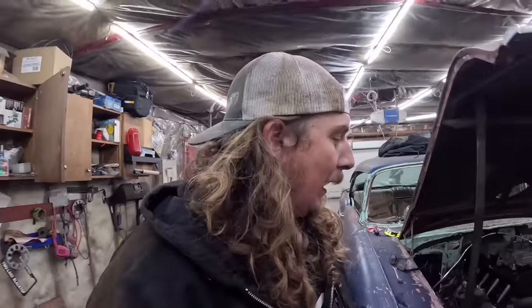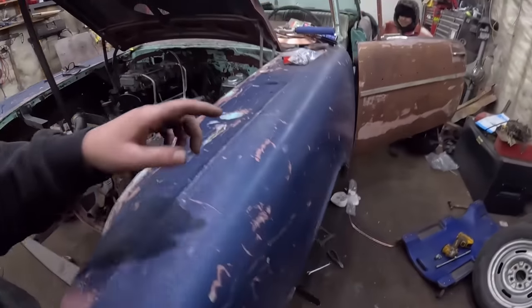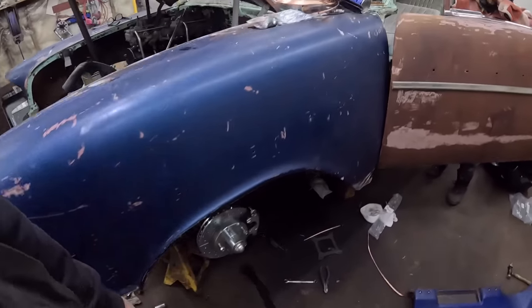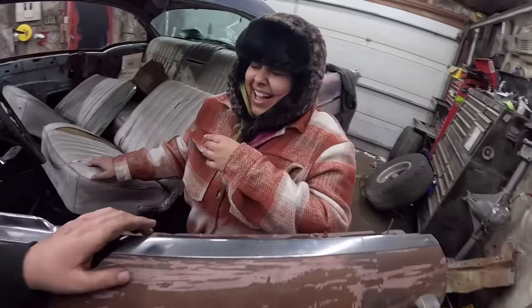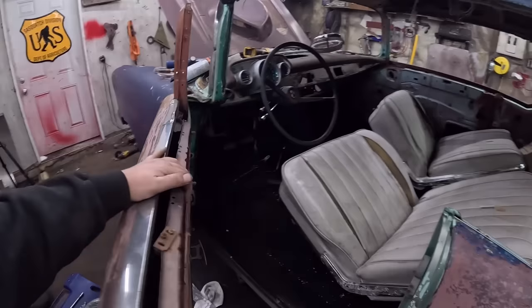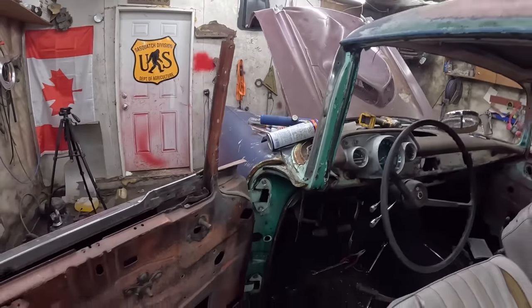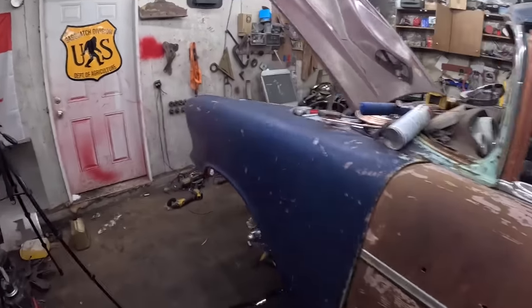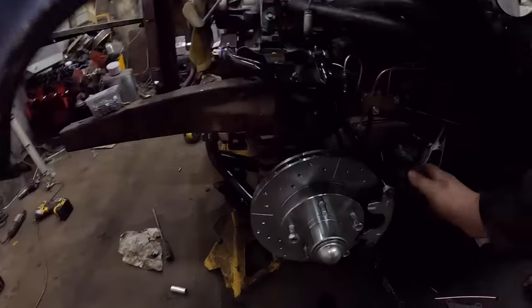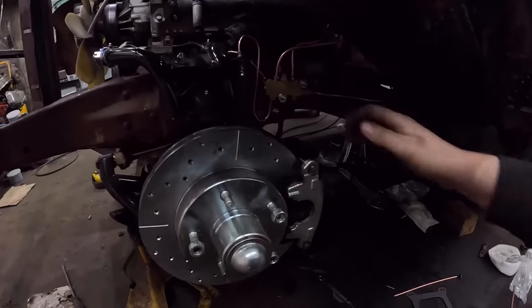One shot. So I got the brake master in. Everything's run. Oh, this one is already self-bled. Hang on here, I want to show something before you hop in there. I don't even need you anymore. Oh, okay, bye! No, it just saves time. So I put the little rod back in. As you can see here, the pedal has a little bit of movement before it actually touches the master. So I was gravity bleeding these things while I was screwing around mostly. So the front one should be okay.